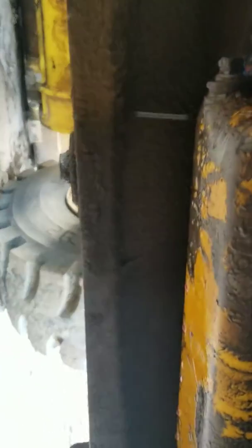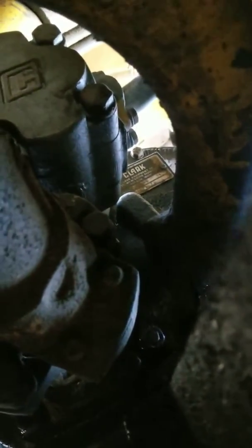Here's the tag for your transmission — mine is a 5421-23. The torque converter tag is up there to the right of that pump — that's an 8502-11. The '5' stands for 15-inch impeller; the other numbers relate to gear ratio and things like that.